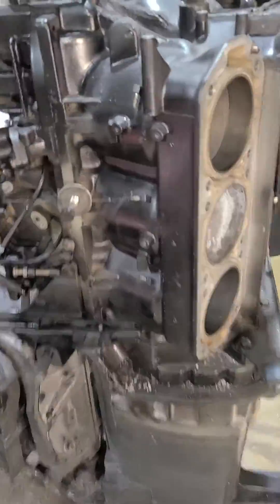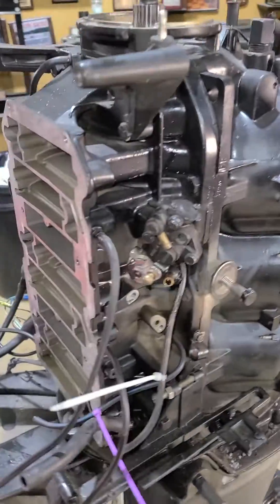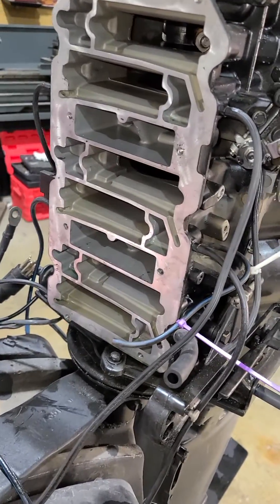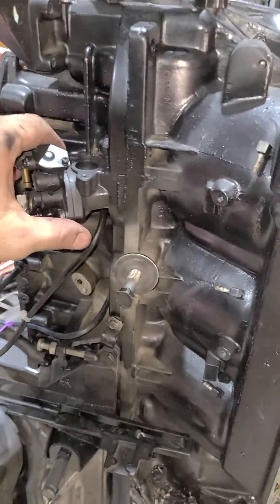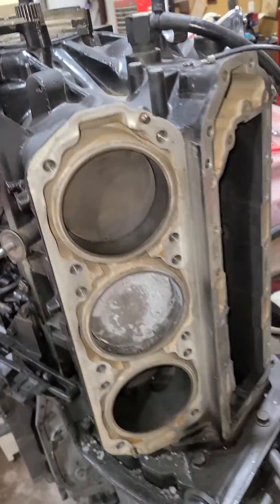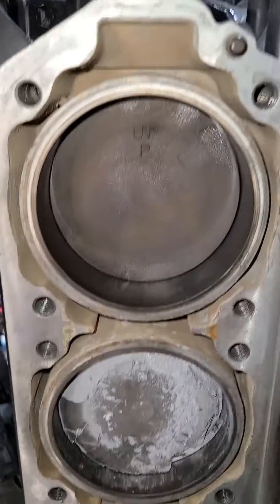The other part is I think they did the oil delete incorrectly on this, and it was running way too lean because of it. I think they didn't seal it right after the oil delete, and there was air leaking into it making it run lean on this side. Right here is where you plug it, and I believe this is the left side that was running lean, which ended up hurting it.